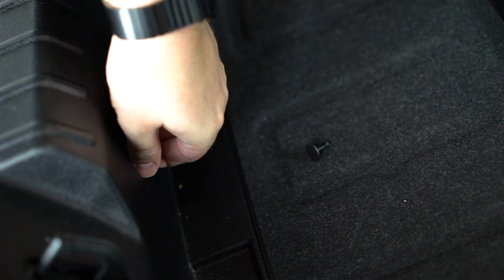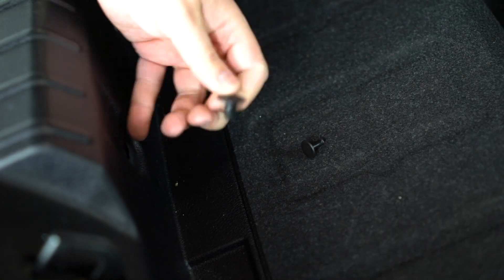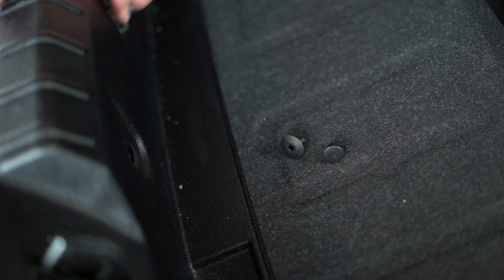With that carpeted panel removed, the next thing we're going to tackle is this rearward plastic panel. It's held in by four plastic rivets. The way we are going to remove these: there's an upper head piece — take our metal panel removal tool, slide that in behind this piece here. This will slide out, and then just with your fingernail or anything that lets you get behind it, lift these out. We're going to do that four times — there's one, two, three, four — and we will come back when those are out.